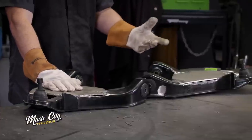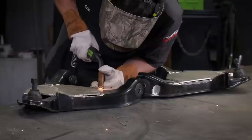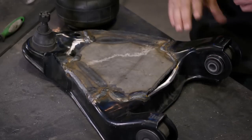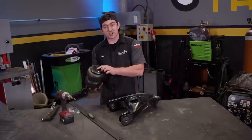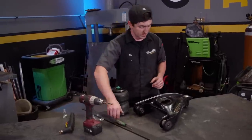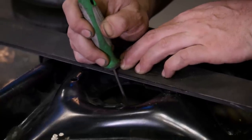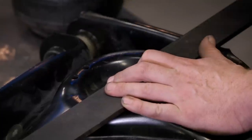We've got our plates cut and fitted, so now it's time to get them tacked up, weld them in, and then we'll be ready to fit the bags. To make sure we don't warp the metal or the control arm, I'm going to weld in opposite corners of the plate. We've got the plates welded onto both control arms now, so there's only a little bit more left before we're ready to get back to the truck. But first, before we get these painted and cleaned up, we've got to find center down here in place of the factory coil spring so we can mount our bag. We've got a single bolt hole here, and we're going to drill two holes and connect them to make a slot, so the bag has a little adjustment on the bottom. To find center, you take a straight edge across the factory coil spring seat right in the middle, take a scribe, scratch a mark, then do the same thing in the other direction, and you're ready to drill.